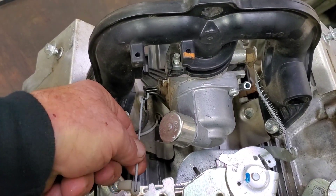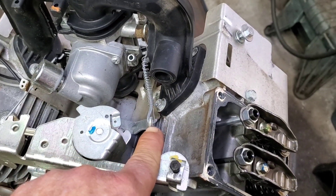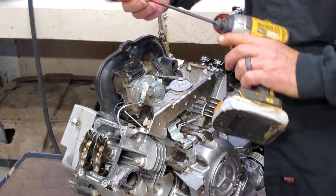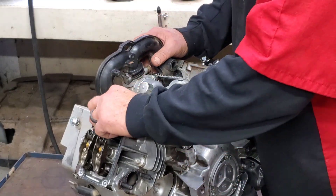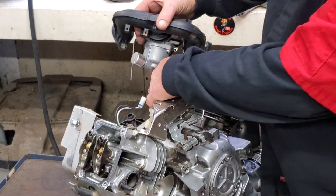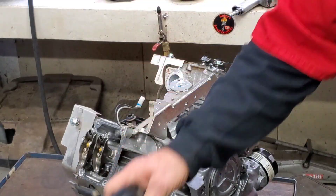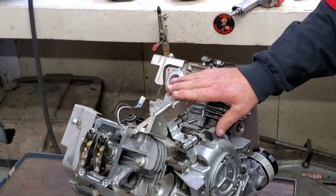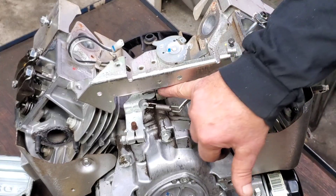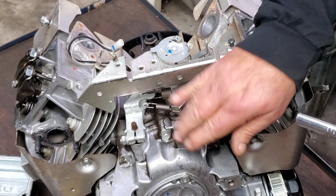On the other side, we just got to unplug our wire, pop that little lever there up, get these other two screws out, and then tilt it around and unhook this linkage. It smells like stinky feet — rotten tire smell or sap, I don't know — but it's awful. Carburetor and intake assembly off. Now let's get this throttle linkage off. I'm taking note of where these two springs are. The reason I'm doing it this way is so I can get this end cover off without taking the governor arm loose.